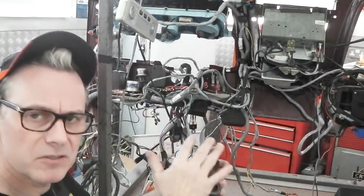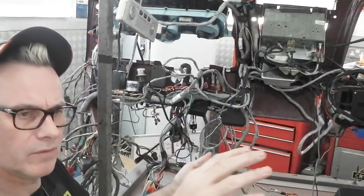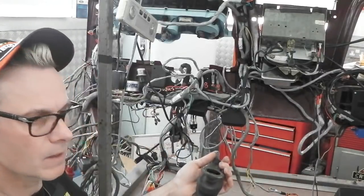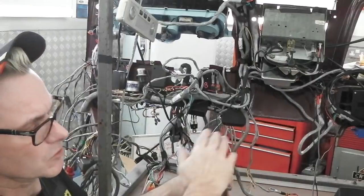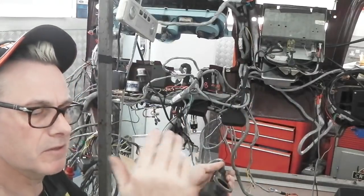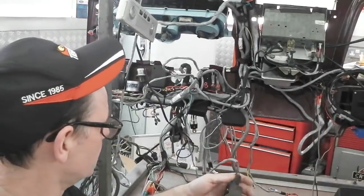Although even by pressing the pedal, I do get a jet, but I might only get a quick jet. This system, when it comes on, will give it two pulses of jet water to the screen, then arm the system. It'll also override and give some wiping action, a delay, and then a final close down. And if there's no rain, the system will go quiet. Nothing will happen. So there's a couple of things going on all in one operation here. It's quite clever.